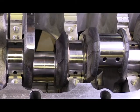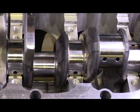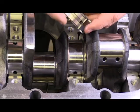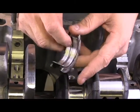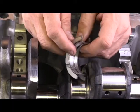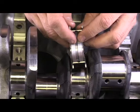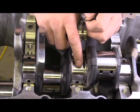There's a specification for each engine — that movement is known as the end play of the crankshaft: how much the crankshaft can move backwards and towards the front of the engine. Some engines have a thrust bearing more like this example. This is off a 1.4 liter engine and the other is a 5.7 liter engine — just showing an example of a main bearing that has the thrust washers installed on the side, called a thrust bearing, typically installed in the middle of the main bearings.